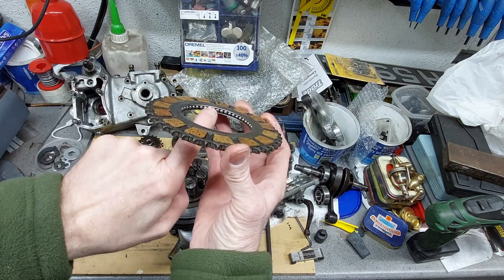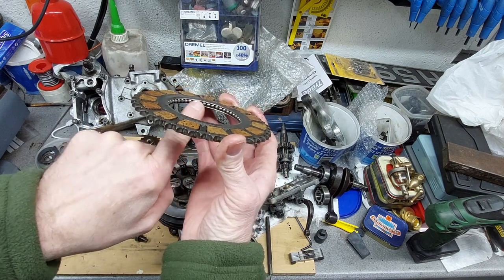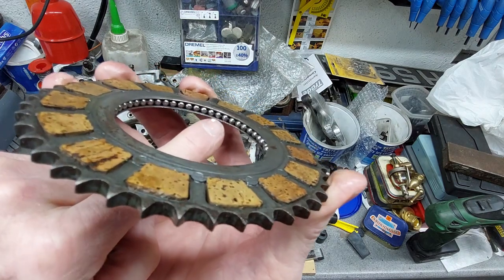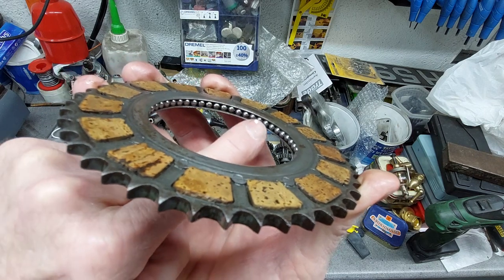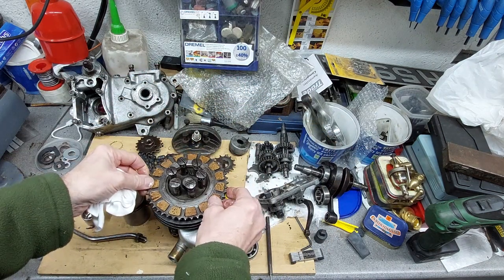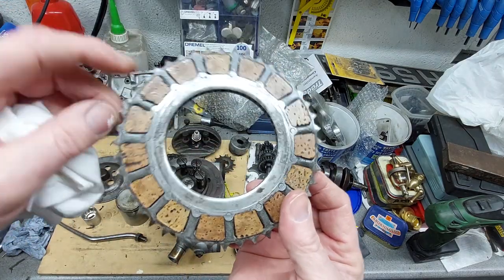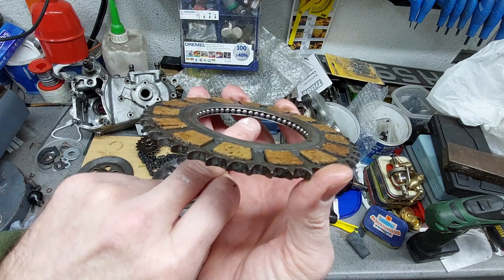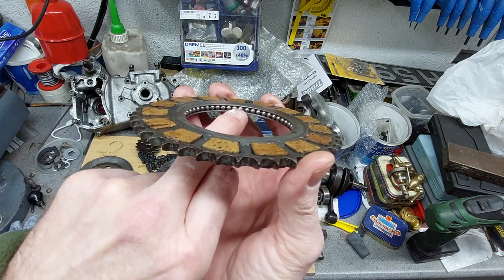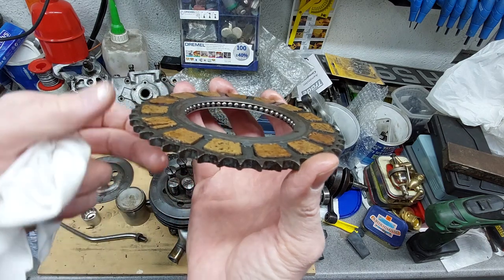The other thing is it's got these ball bearings all the way around, and I think at some time in its life it's been stood somewhere for a long time and not used, because some of these ball bearings, these ones, I don't know if you can see there, they're really rough where they've been rusty and then been used again, and I think they're quite worn because they don't seem to be riding too much on the clutch inner plate there. So playing with these, I think they're just standard imperial ball bearings, is to just ease the sides open slightly with a punch, just a little way, so that I can get the ball bearings to drop out, and then drop them all out, drop new ones in, and then just gently tap it back into place. So that'd be that.